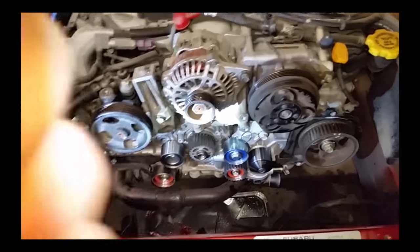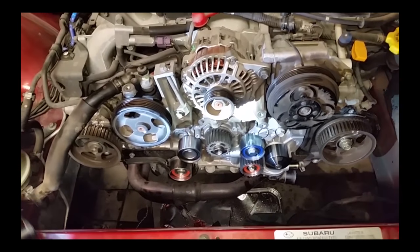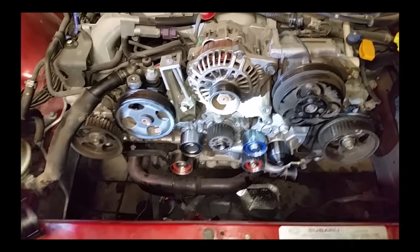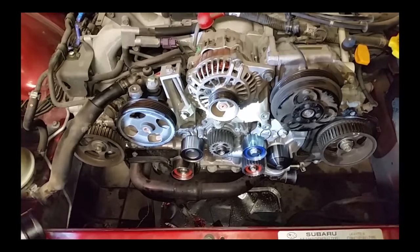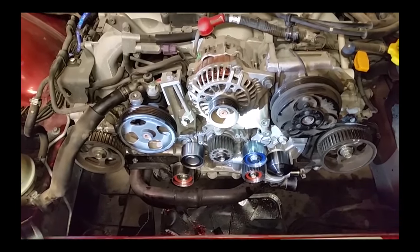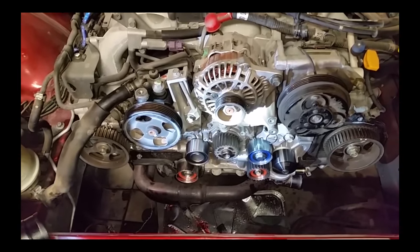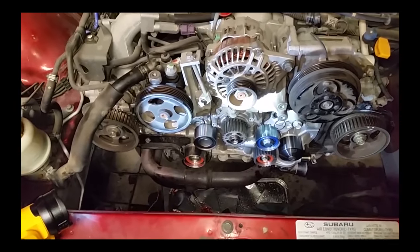But had to get fluid. So I got radiator fluid, coolant, Pentofrost. Going to mix that up. It's a concentrate. I've got some water to mix that up with, distilled. It called for deionized or distilled. I'm not sure. The bottle says deionized. On the data sheet, it says distilled. So we're using a reverse osmosis, well, it is steam vaporized, distilled, to remove bacteria and a couple other things. So hopefully this will be good enough for this.